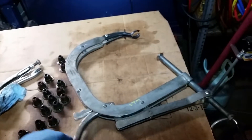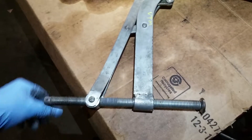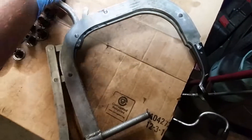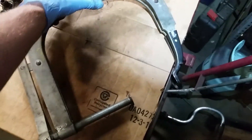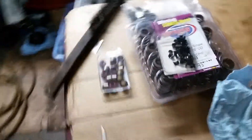This thing works great as usual. You adjust this end here to where it'll fit on the valve, and this will go around the spring and the retainer. You can adjust it open or closed with this thumb wheel right here. Once you have it sitting on top of the valve, you just crank that baby over and as you can see it squeezes in and locks in place. You can pop your keepers out of here, release it, and take the valve springs out. I stripped these heads down — the valves are sitting over there in a tray — and the old valve train and old beehives are over here.